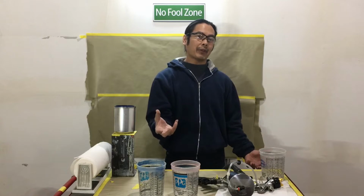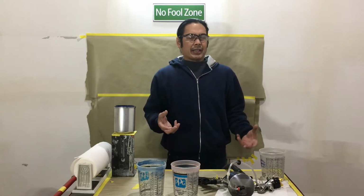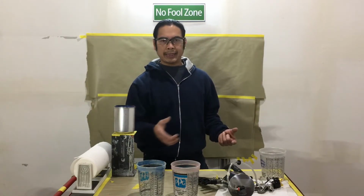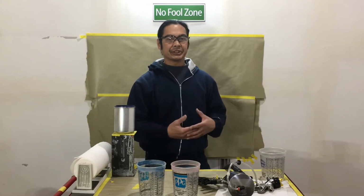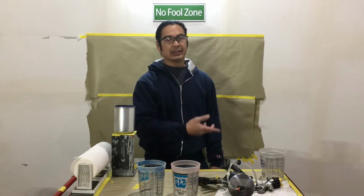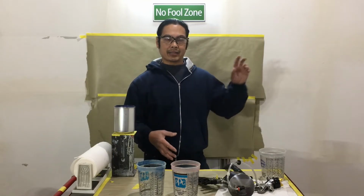And how do I know? Because I've been exposed to the point where I've felt those symptoms. You're going to feel like you have congestion. I've seen painters who are spraying, and I could tell they're already sensitized, and they're spraying with some pretty vicious isocyanates in the paint, and their nose is just running. Right? That person needs to be in a fresh air respirator, or get the heck out of that environment and get to some fresh air.